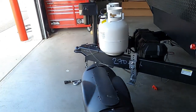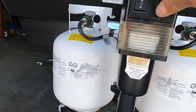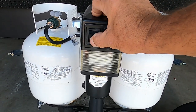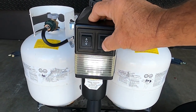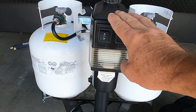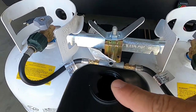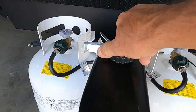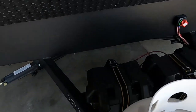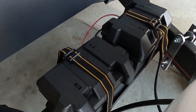Once we arrive and unhook our hitch, the first thing we're going to do is level our unit. The unit comes with a power tongue jack — simply raise or lower the unit to your level. There's a night docking light should you arrive at night. If you lose power, underneath this rubber stopper right here is a spot for a hand crank to get this up and down. Speaking of power, check your battery posts every now and then to make sure they haven't wiggled loose going down the road.